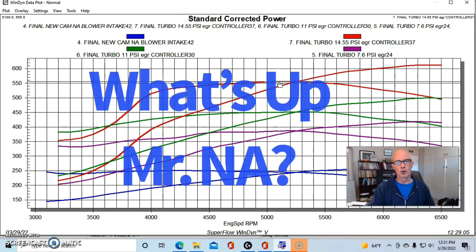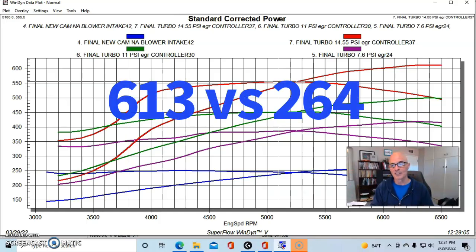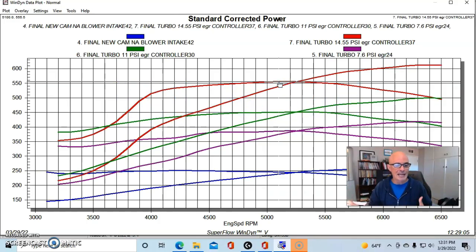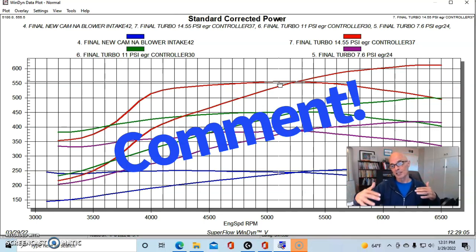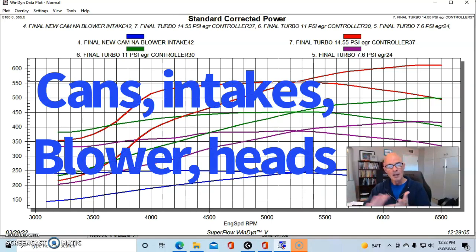The thing I'm wondering is why was our NA motor only making about 265 horsepower, yet our turbo combination was making 613 horsepower at roughly one atmosphere of boost? Some of that is E85 — on a low compression NA motor like this 3800 I haven't seen much power gain from E85 in NA trim, but there is some extra gain under boost. Is this combination just more efficient under boost? Is the NIC cam from ZZP actually a really good turbo cam? Let me know what you think in the comments.